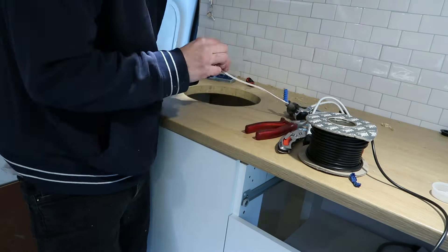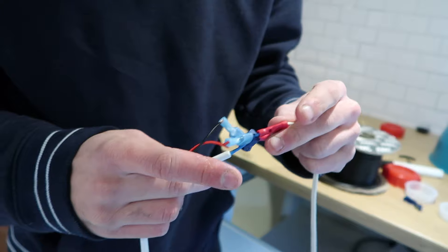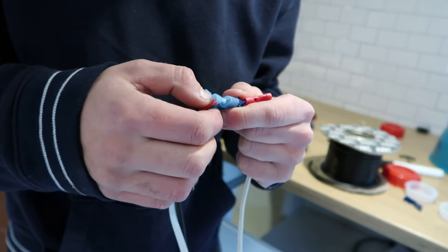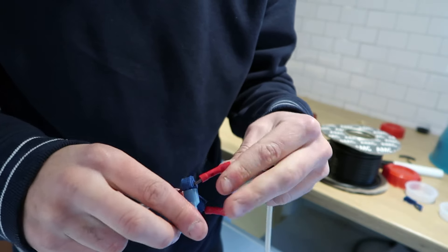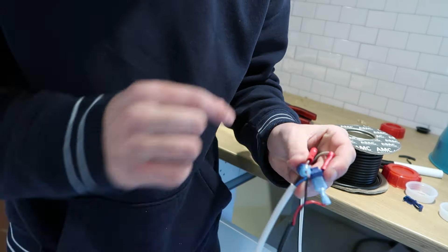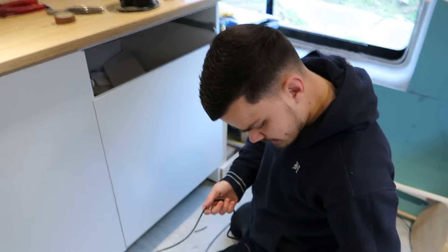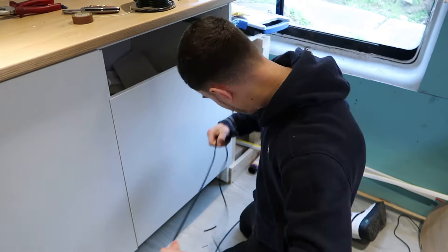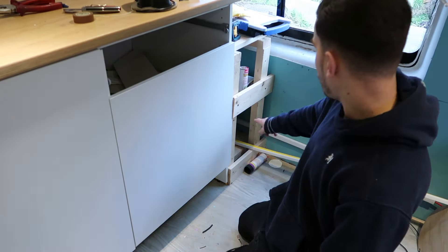The first time I connected it up a little bit wrong, so what I've done is got the positive tap connector to the positive pump, then I've got some 12-volt cable and run it off the two connectors together, and done the same with the negative. Now what we're going to do is connect it up to our fuse board — whatever you want to call it — and hopefully this thing works. I've got some empty trunking already in place which I run it along with all the other wires and connect out to the fuse board.